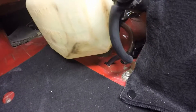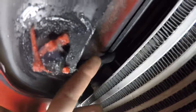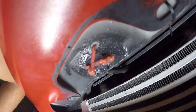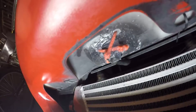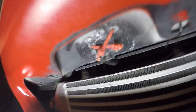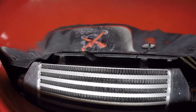I would have left a grommet but there was no room anymore, so if the line gets cut I'll fix it then and do something different. That line comes down, up and over the rear end, and then follows the brake lines up to the front of the car. Here in the front, the brake line comes up — this is the spray nozzle off a Lexus or something fancy. I only got it because it has a good spray pattern instead of two jets. I mounted it with silicone originally and then used zip ties to hold it, but the silicone got all over the zip ties so I just siliconed everything.